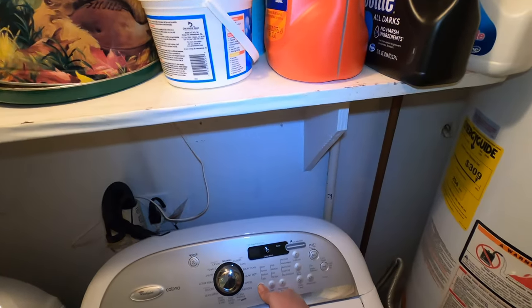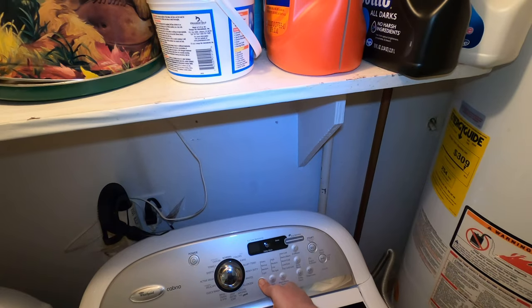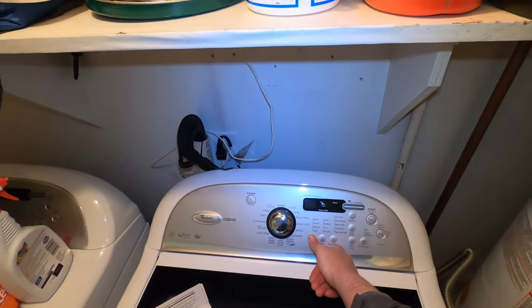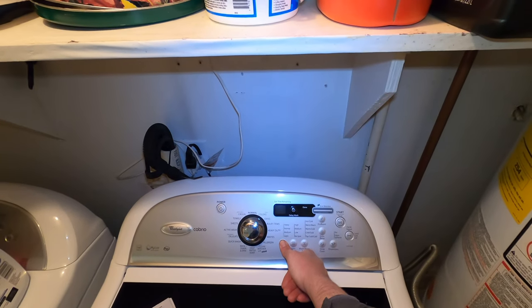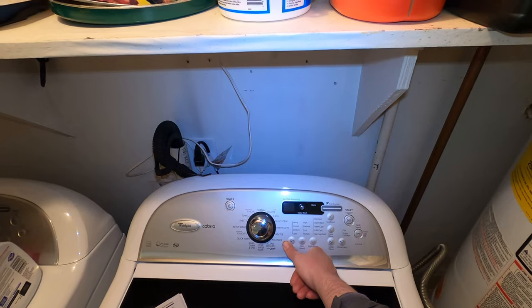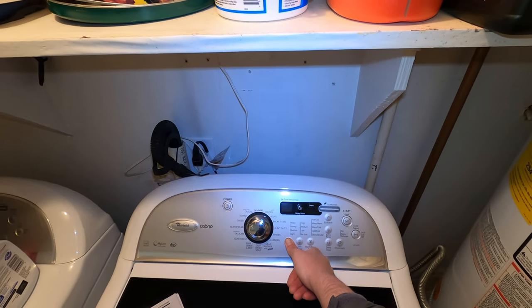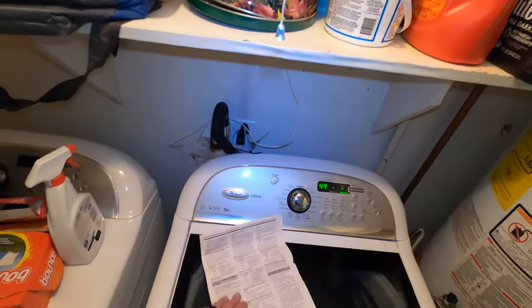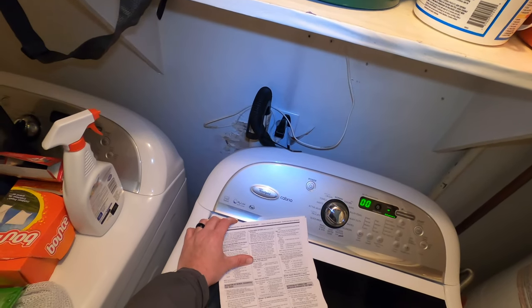The step that I missed — right after you see all those lights turn on when you enter diagnostics, is the button that you were using to enter diagnostics, you've got to hit it once more within five seconds or three seconds, something like that. You'll see me hit it again. Boom. So this here is manual test.